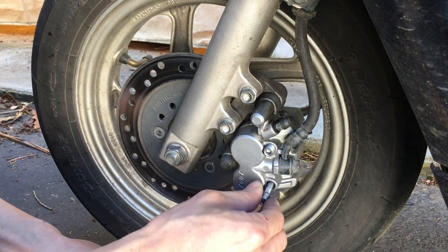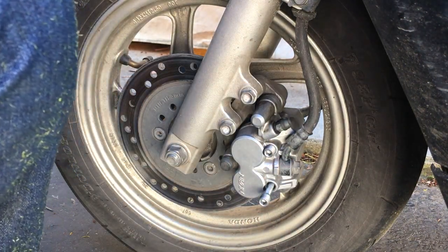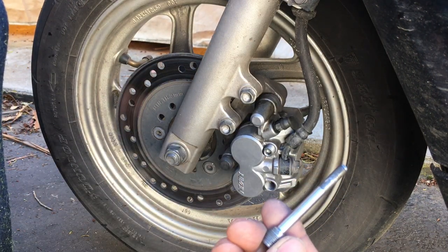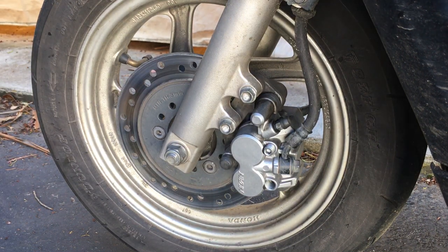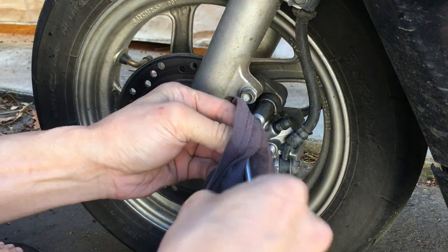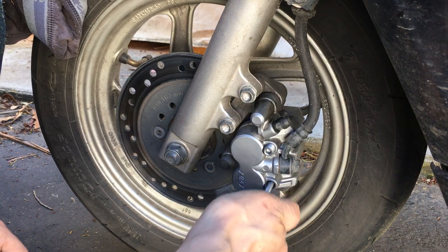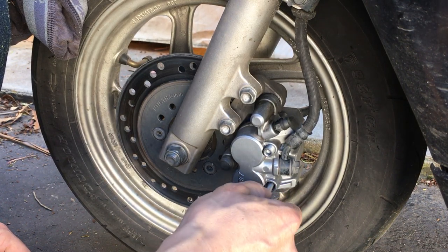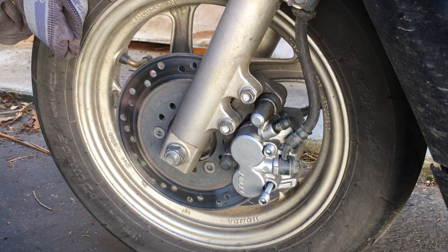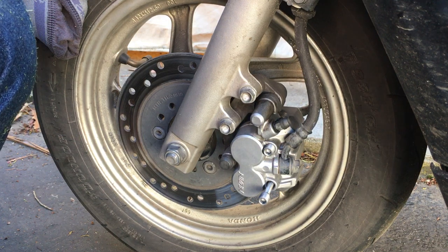These things were coated but had gotten dirty, and you can see the dirtiness that came off. That was a big improvement — prior to this I had to really yank on the pin to get it out, but now it just slides right in nice and smooth into the caliper. Hopefully this will cure my fast pad wear. See you guys next time.